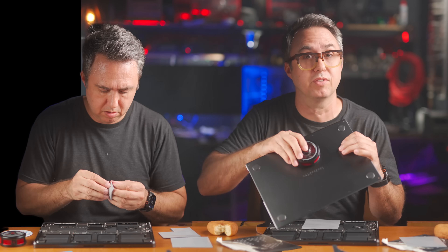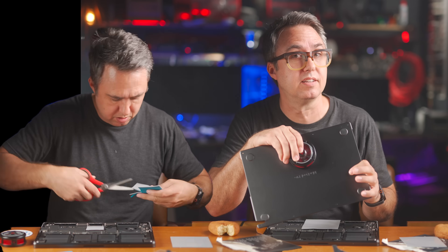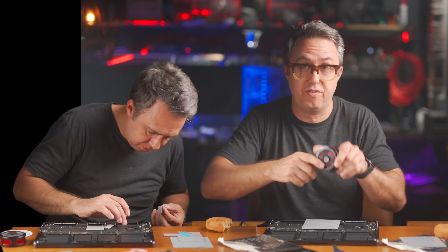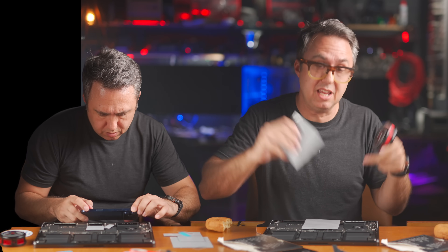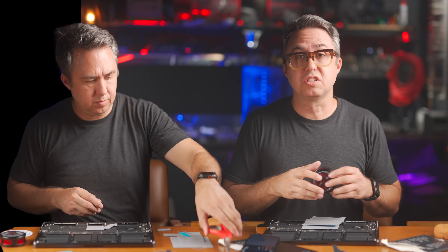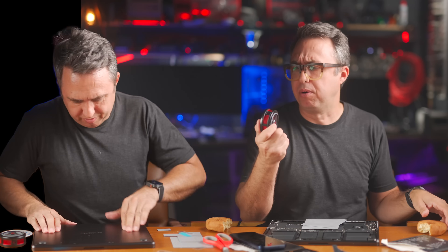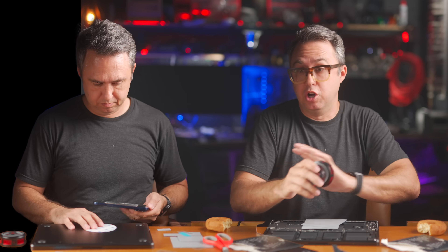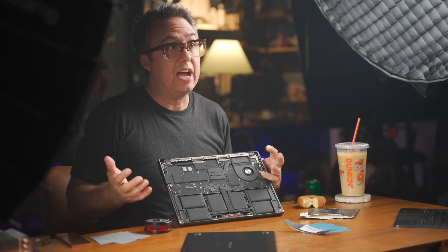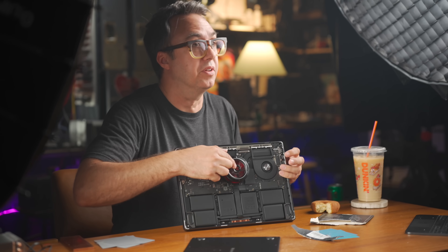That's going to heat up the bottom plate of the laptop, and then I'm going to use this device. This thing uses a completely different type of physics hack, harnessing the Peltier effect — a thermoelectric cooling device. When you give this little puck power, the bottom of it gets super cold, the inside gets super hot, and a fan blows all the heat out into the air. This thing is not nearly as efficient, nor are thermal pads nearly as efficient at moving heat as heat pipes are. But without any question, some additional heat is going to get yanked off the CPU doing this. This completely destroys the efficiency of using a MacBook — it pulls an additional 30 watts. We're doubling the power needed to run the computer to siphon off just a couple of extra watts, but I think it'll be noticeable. We're only working with 30 watts coming out of the CPU, and I only need to extract maybe 5 or 10 watts to make a measurable difference in speed.